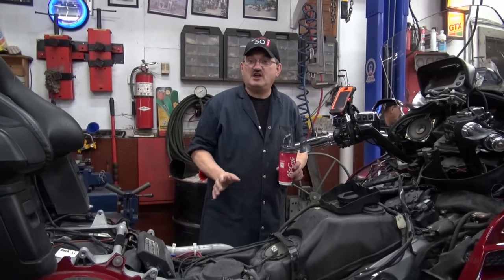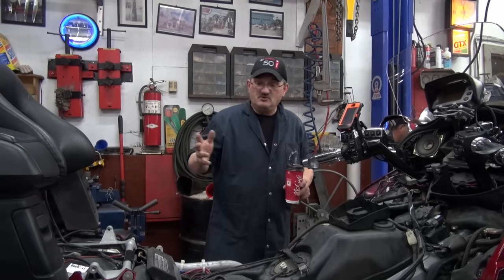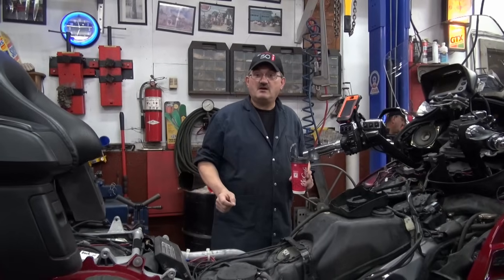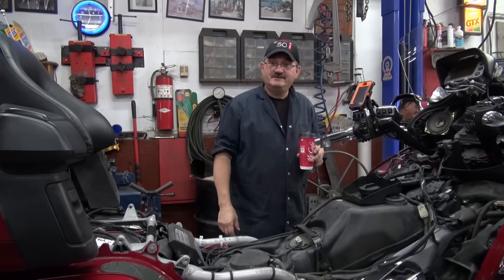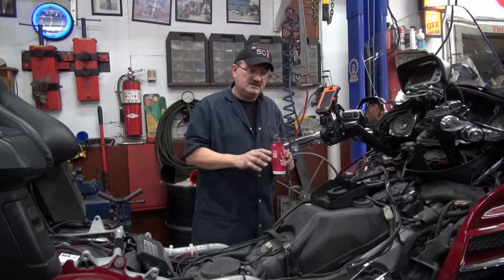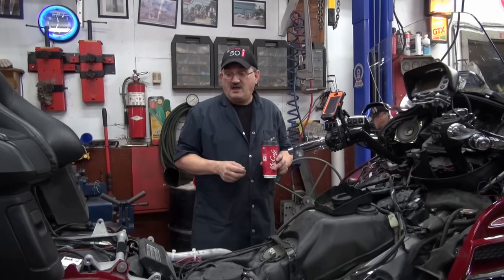The bike's been here for two weeks now. It came in to change the oil, which was a month and a half overdue, but we didn't get to use the bike a lot this summer. We changed the oil, and the rear differential fluid and stuff is all done. So now I'll go back at the fork seal — the fork seal's got one little small weep. We shoved the new back tire on already, we're going to put a new front tire on, and we'll do the fork seals. So we're going to reverse the procedure with regards to the air filter, and I hope you enjoyed it. Even for the guys who haven't had a Goldwing, it'll give you an appreciation of just how complicated these bikes can be. Fortunately, they don't give a lot of trouble — it's pretty well a maintenance-free bike.